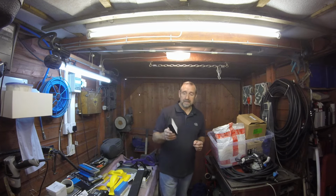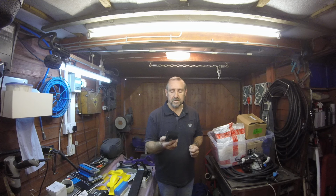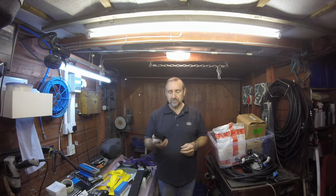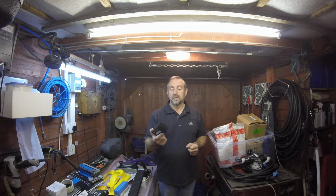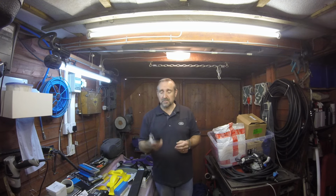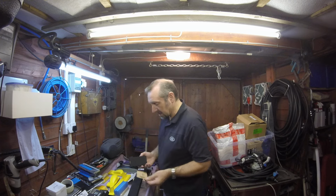So I always go a little bit more hard work, maybe, not necessarily so, as I say, with the nice fillers we use today, but use the finer grits to start with. It's very rare for primer to sink into 120 or 180 grits 6 months down the line and cause you a problem. Even if it does sink back, you shouldn't see those marks with the right paper.